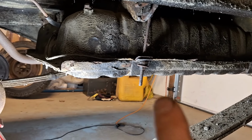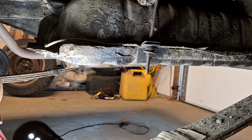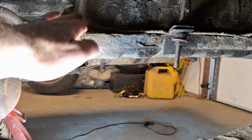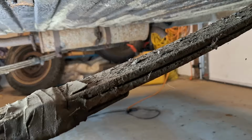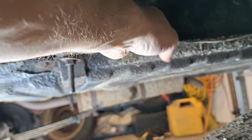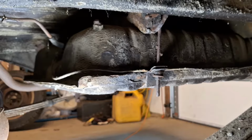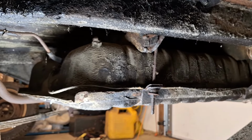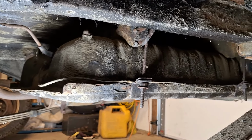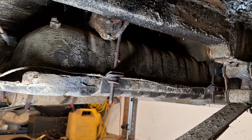1/2 inch nut over here. And then it looks like maybe a 5/8 or a 3/4 right above it. So I'm going to start taking those down. But I wanted to make sure the wire for the sending unit was loose and found some chunkiness up in here. So don't have high hopes for the tank. I might have to replace it, but we do sell these and they're pretty inexpensive. Dynacorn actually carries them. So we're going to do that, but also have to disconnect the fuel filler hose.